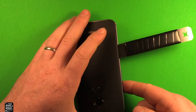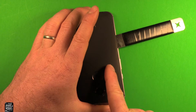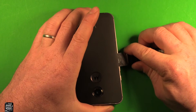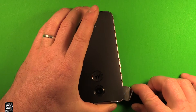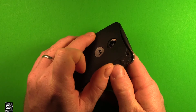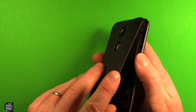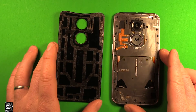When you get up close to the volume and power buttons, you want to be careful. There are some wires in there, but as long as you stay close to the edge you're fine going through here. Just keep working your way all the way around, then once everything is quite loose, start lifting up however it wants to come off best. The back cover comes right off like that.